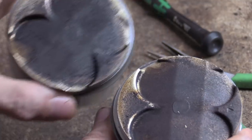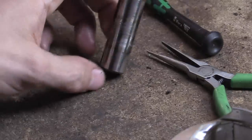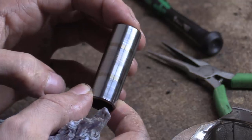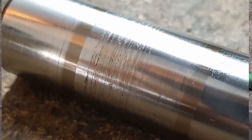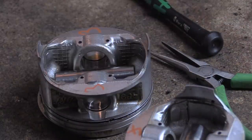The difference is not that much — you'd expect a night and day difference if there were a serious problem, like one being black and one basically silver. The skirts and everything look fine. But if we look at this wrist pin, this seems to be the worst one — real spalling going on, just grabbing and grinding over time. This is a long process though. As we move from bank one to bank four, bank four seems to be suffering ever so slightly, and so does number three.